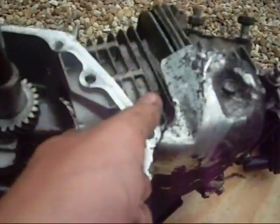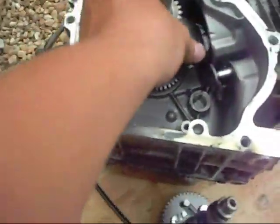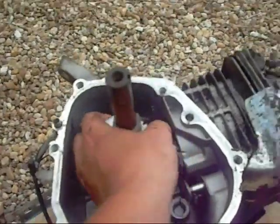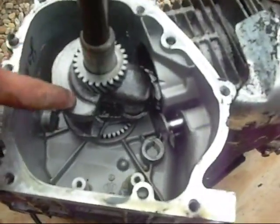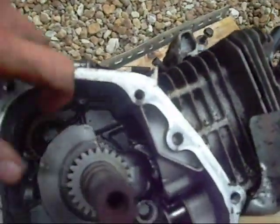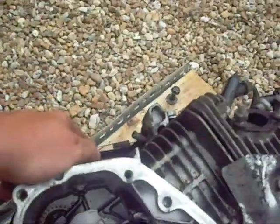But it's not, because the piston seized while it was running, and of course there's lots of momentum going. So it's like: this end's not moving anymore, but this end keeps going — and it breaks right there. You can see there's lots of scoring down to the counterweight. If we look back there, you see a little plastic gear connected to a lever — that works the governor, and that also needs to be working properly.